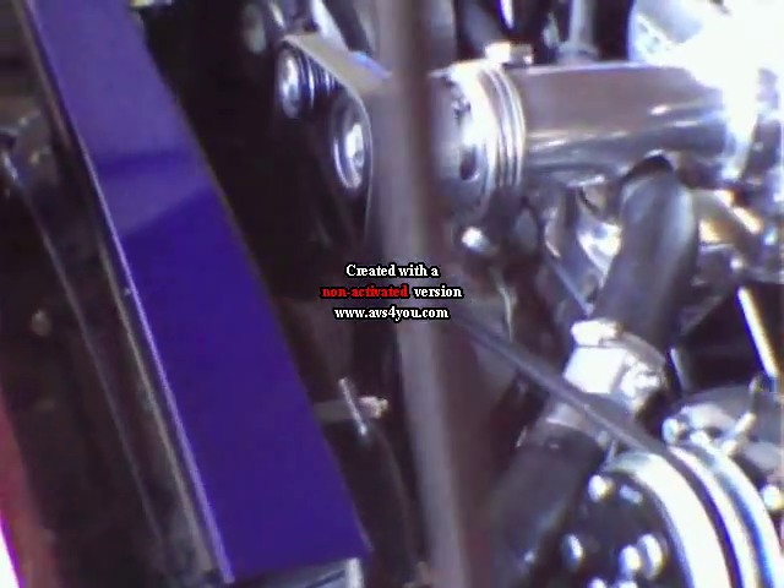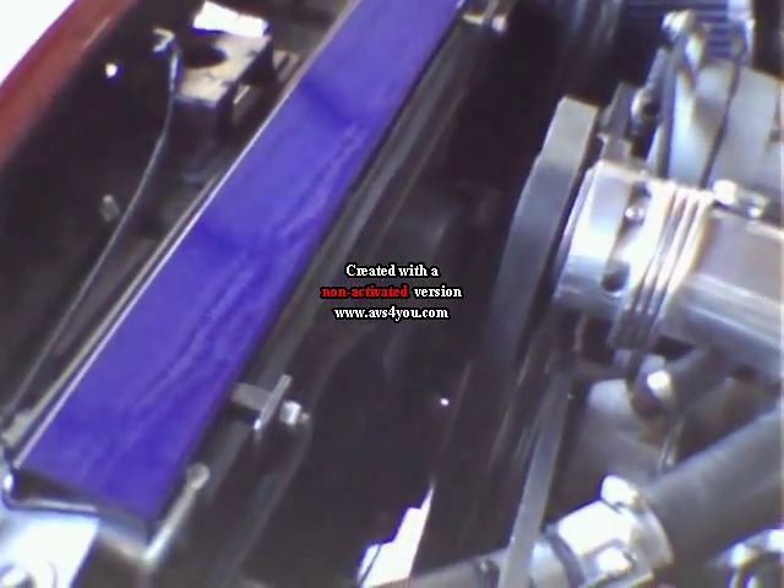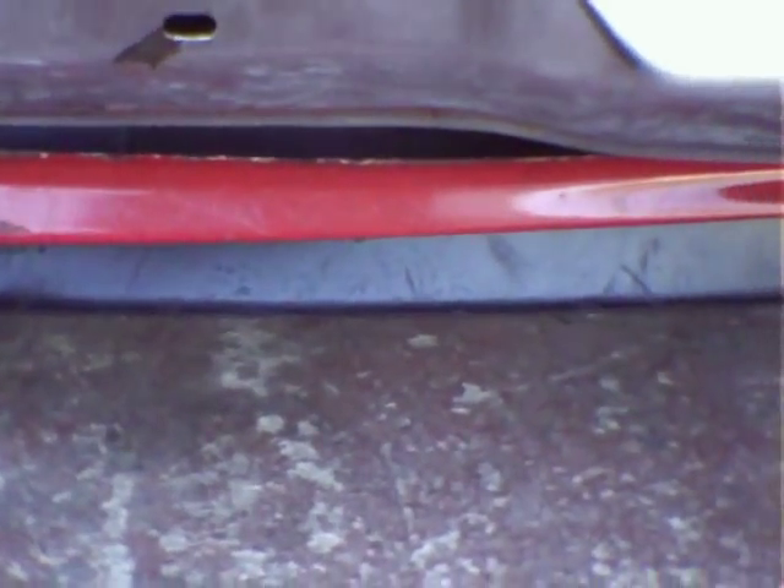There's an aluminum radiator made by Dillon Manufacturing. If you look really close you can see the electric fan down there — it's real tight. The fan has to be offset from the water pump so it'll fit, but it all works. Up front at the grill you can see there's a transmission cooler in front of the condenser, and the condenser is in front of the radiator. It all runs pretty cool. I put what's called a chin spoiler under here — that black piece of plastic — which helps prevent the fan air from recirculating through the radiator and increasing the temperature.